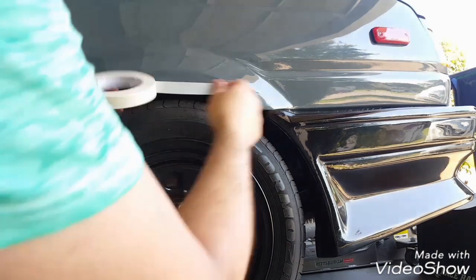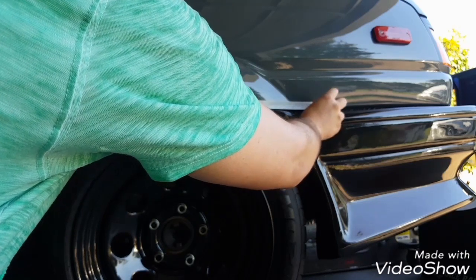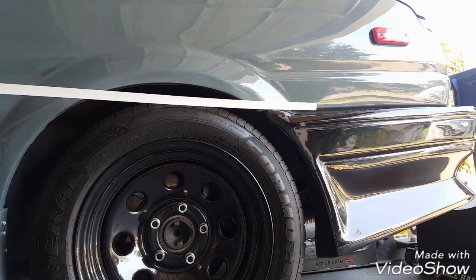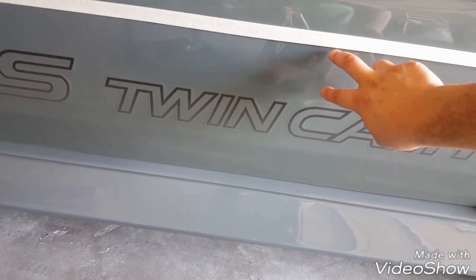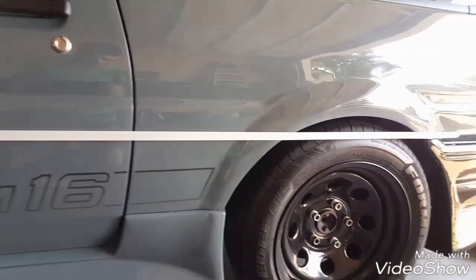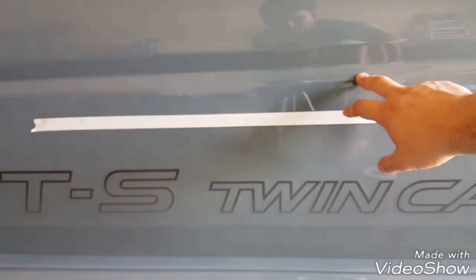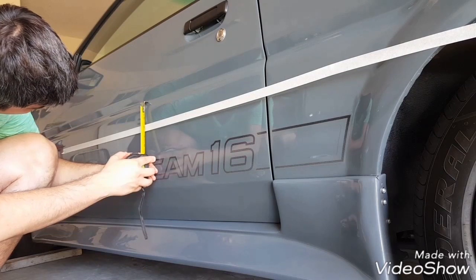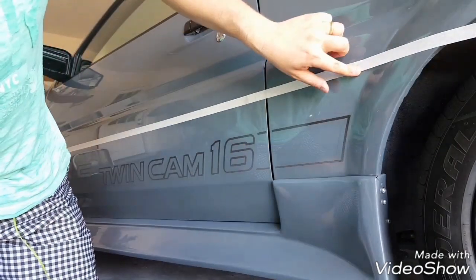So I'm going to start over here. This is the end here — the tape bends, so you've got to be careful with that too. The top of the molding will be at the bottom of this tape. What I want to do might actually be easier if I measured from this body line and down. So let me do that and make sure I get a consistent number. I'm getting about three and a quarter right there.